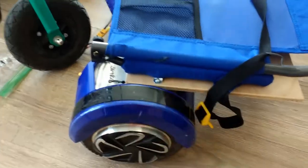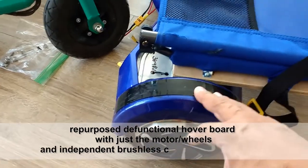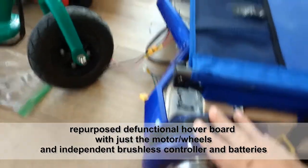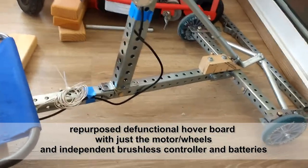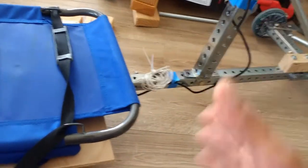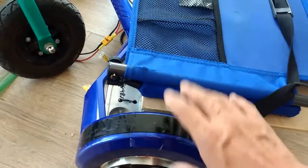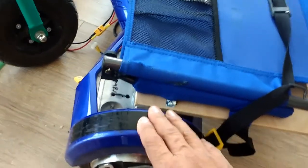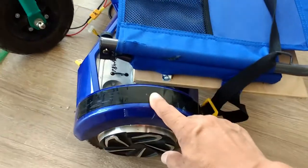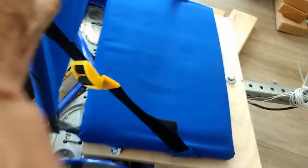This is one of the least of my concerns here, but I wanted to bring it out because these things do use electronic stabilizers. It's better to gut them out like I did here and make yourself a proper car like this — not a wannabe go-kart with those attachments you can buy. To me, it's better, especially if you have an older unit that's not working, to gut it out completely and use separate controllers on each wheel. These are brushless motors inside the wheel, so you use one brushless controller for each wheel — that's how I'm controlling this — and you can make yourself a go-kart very similar to this one.